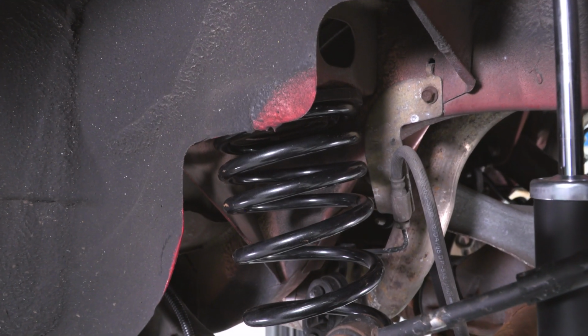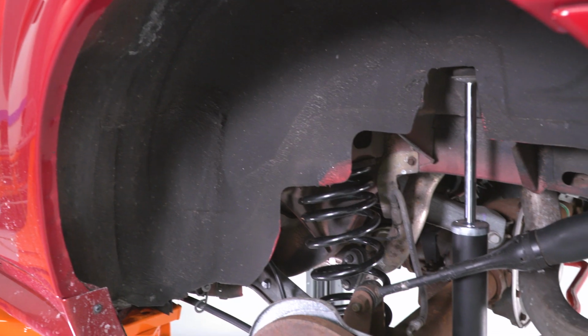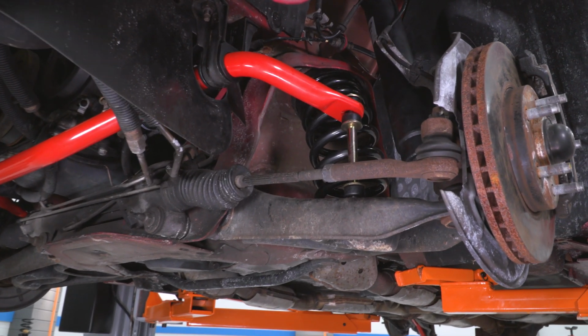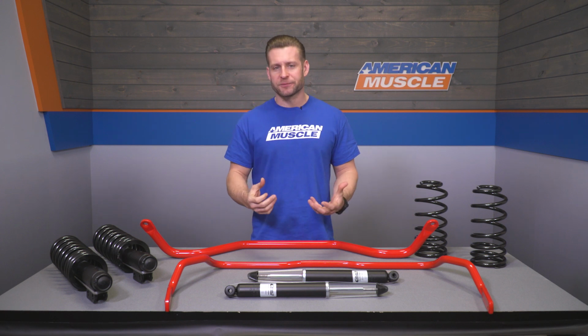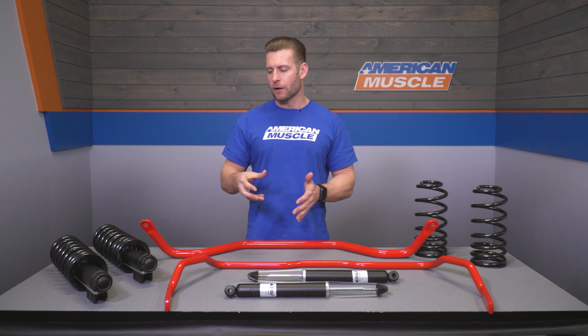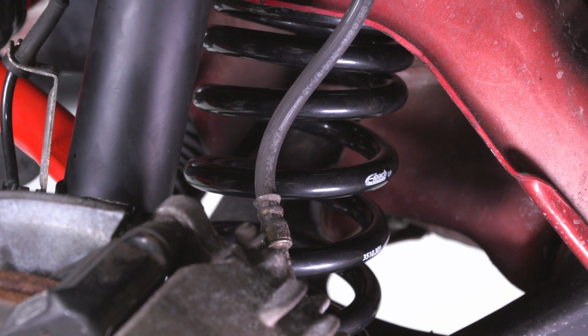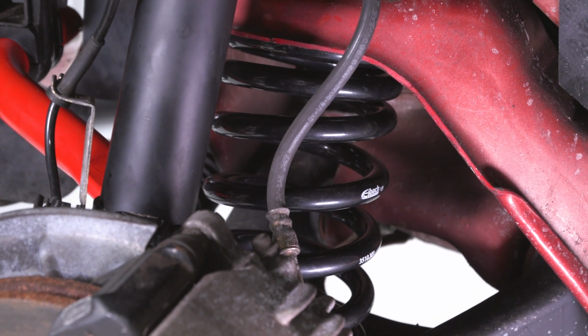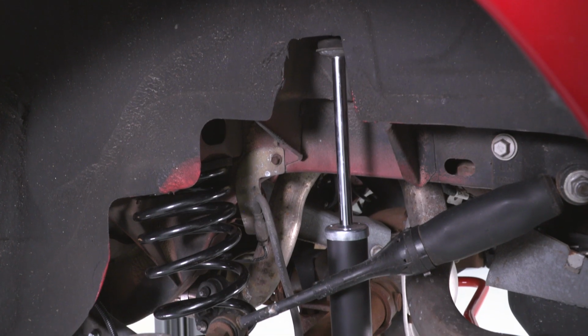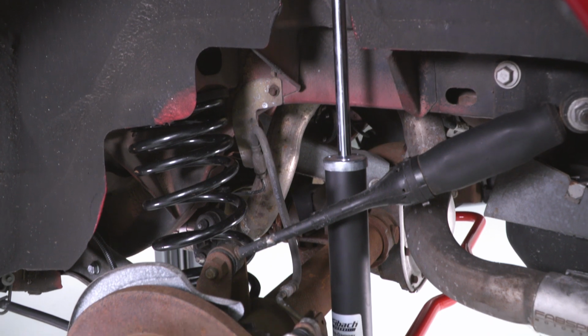Now the Pro Kit springs that we do have here guys do feature that progressive or multi-rate spring design, which is something I always think is a great choice for street cars, because that softer initial spring rate's going to be relatively comfortable for cruising, but once you start pushing the car hard and start rolling into that firmer rate, these things do tend to firm up obviously, and that's where you're going to be reducing some of that roll even further. Now specific spring rates for the Pro Kit springs do include 502 to 570 pounds for the fronts and 171 to 314 pounds for the rear.